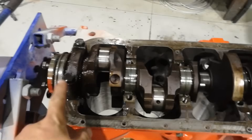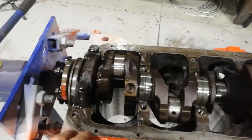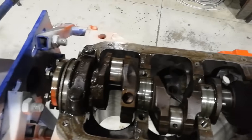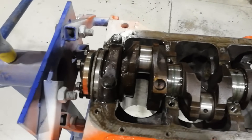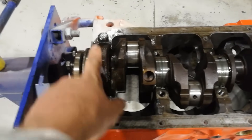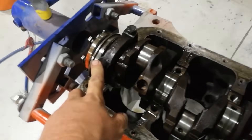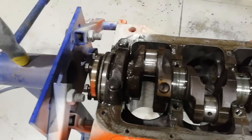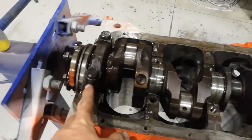I had to pause the time lapse on this build because right off the get-go I had trouble putting this crank in. I know the crank came out perfectly fine and it should go in perfectly fine - I've got all the bearings in the right spot, they're all nicely worn in, not tight. But every time I tightened up the rear main where the felt seals are, it would just lock the crank up too tight. Under this cradle there are two in the crankcase, and here there are two split seals made of felt - like a rope that you feed in and tighten up.